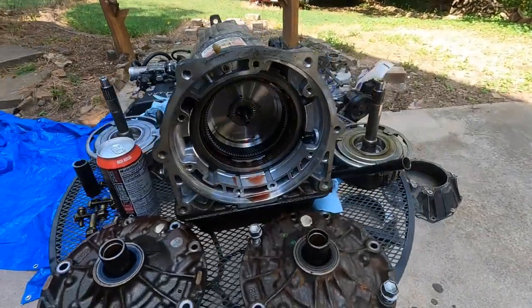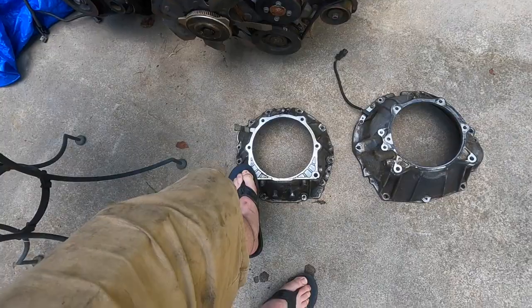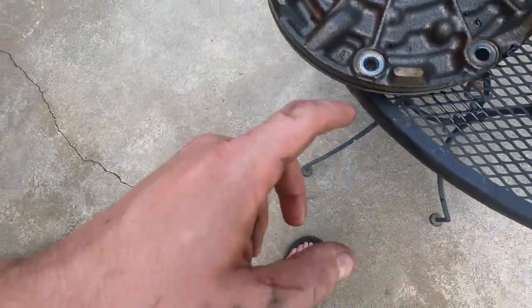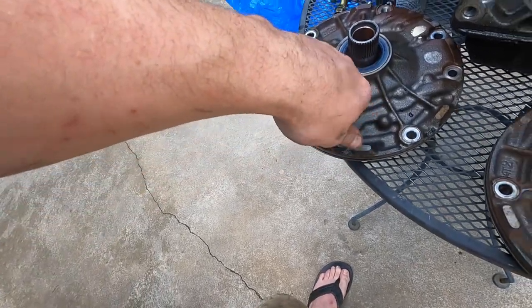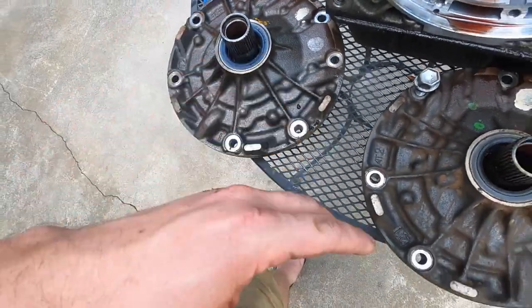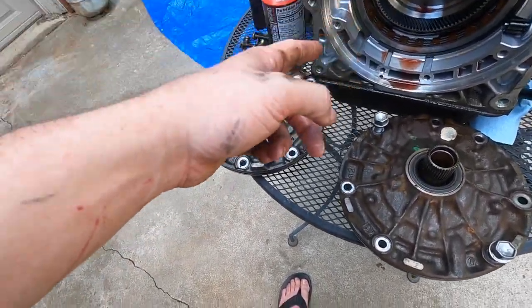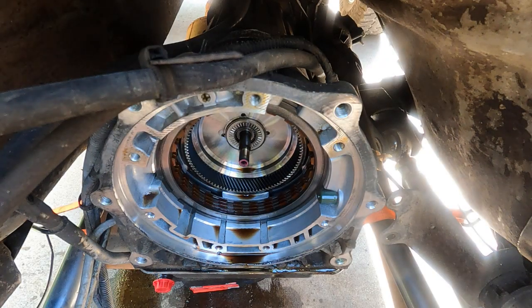Right now we'll just get the engine in. Inside the bell housing there are four 14-millimeter bolts and two 17-millimeter bolts, then the bell housing comes off. The pump cover is all 12 millimeters — two of them are threaded, so you thread some bolts in there and you can pull the pump out. It didn't take a whole lot of effort. Counting the pump gears, I got 38 on both, so they're the same. The bushing IDs may be different but I highly doubt it. So we're going to start putting all the A650E internals into the AW4.